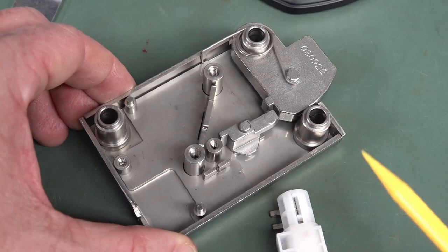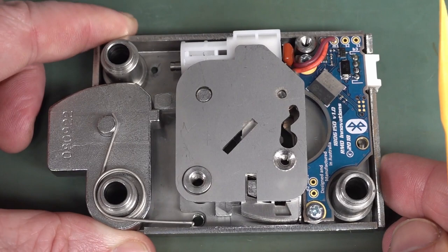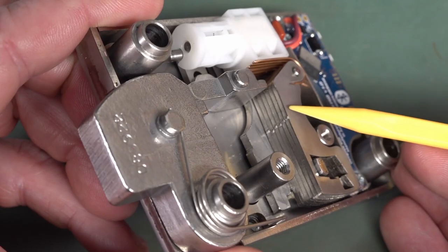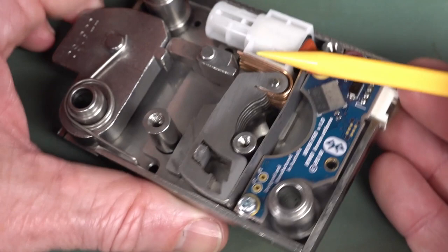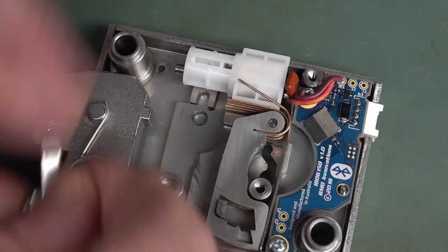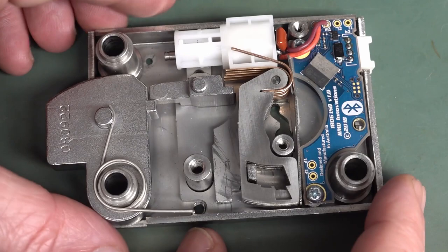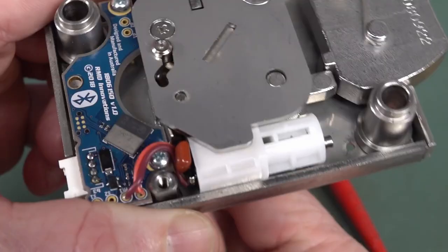Here's inside the 1000 Series Bluetooth lock with wave-key override. I've taken the screw out. If we take that plate off - ta-da! This is a six-lever design. They've got a back plate just to keep everything in place, and these springs up against the solenoid just allow the plates to swing back. That's exactly the same arrangement except they've added the key override in there - that's quite novel how they've done that. This is a universal mounting footprint so they all have to fit within those constraints. That allows both the solenoid and the key to actually operate the mechanism.